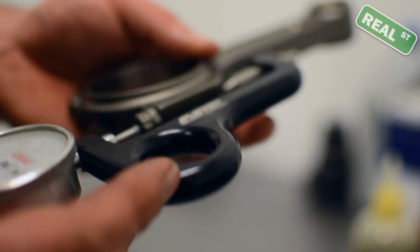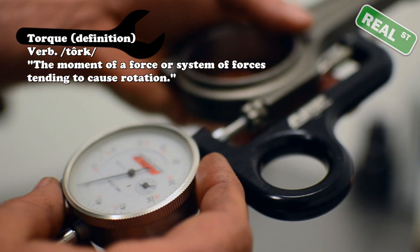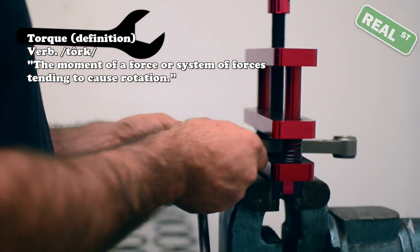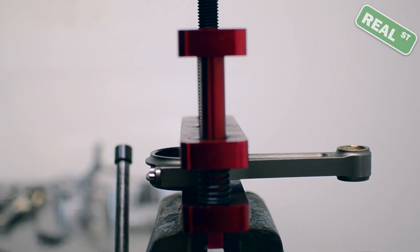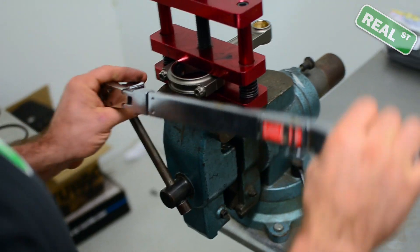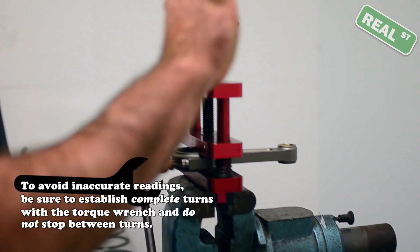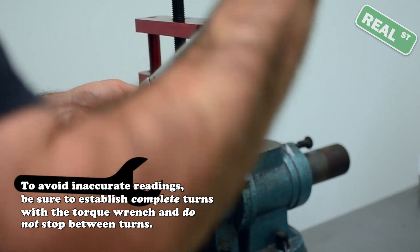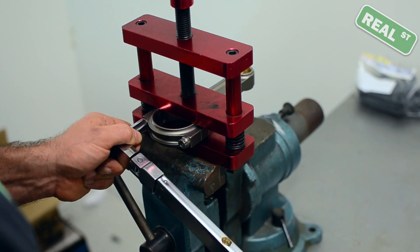Once you've got the gauge zeroed out and the bolt is not torqued, you can run it up and then check stretch. While you're torquing the bolt, it's important that you have a known good torque wrench and that you are strong enough to torque the fastener up in an even pull. You do not want to be bouncing on this wrench to tighten it up. Just nose it up to get the bolt tight and the rod, and then run it into its stretch.